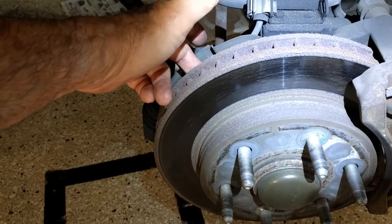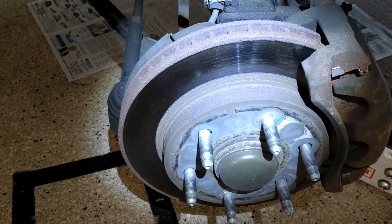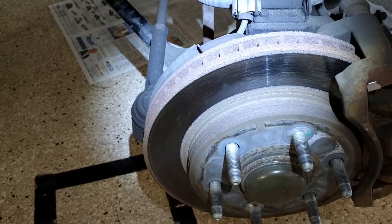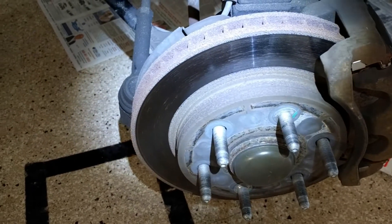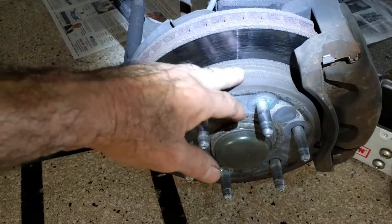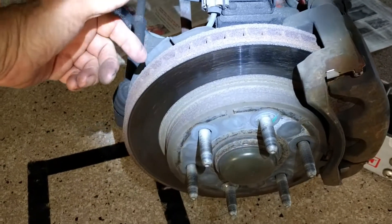I'm thinking that's what I've got. I'm not going to do it right now because you have to pull the rotor, the caliper — not that big a deal, but it is a bit of work. The pads and rotors on this are good, so I don't need to do that service right now. Also, if the ABS light is on, you still have full braking capability — you just don't have ABS braking. So I can put it off a little bit. If I ever need to take these rotors and calipers off, or if I just get an urge to make that light go out, I'll probably buy two new sensors — left and right — and do that procedure for cleaning up the mounting area on the hub.